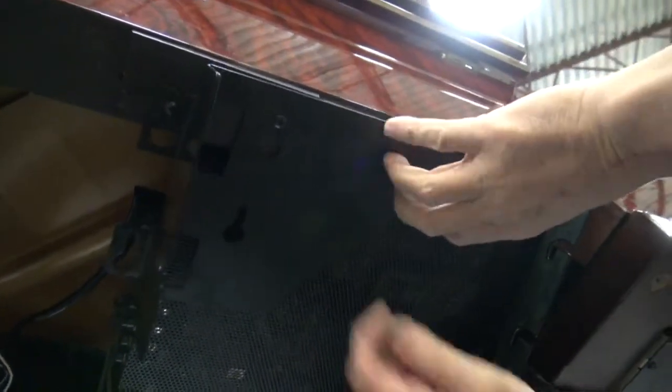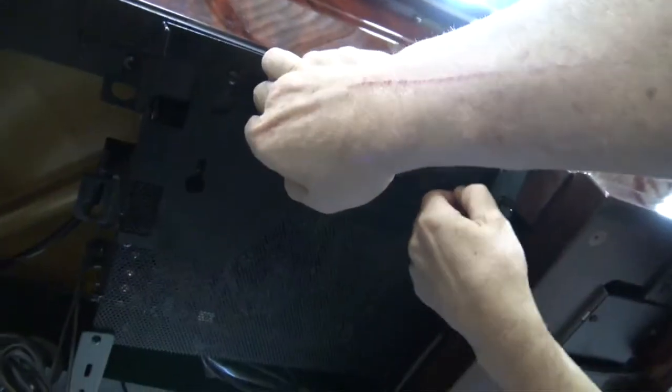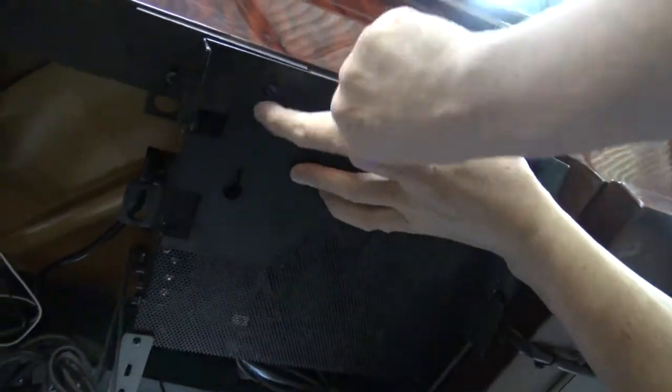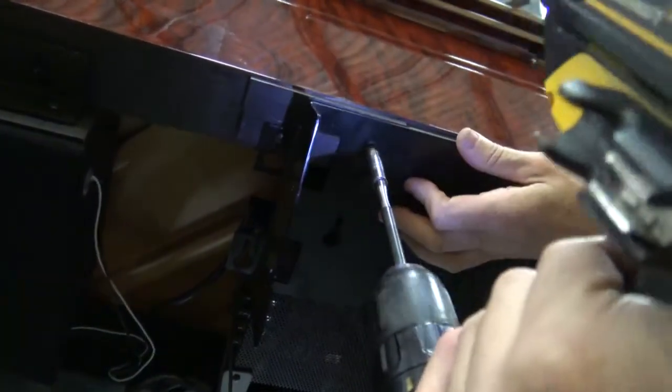You see we've got two screws here and some wood that I placed in between the brackets that hold the power supply. So this is going to be located just like this. If you see these two screws here, you're going to slide this back on those two screws. Then over here there are two other holes for screws, so I'm going to put one in here like this and then the other one in the other hole. These two slots allow you to place the bracket up. Then you're going to take your screwdriver and tighten these Phillips head screws — one, two, three, four. Now this is totally sturdy.